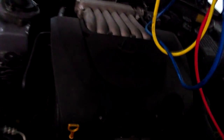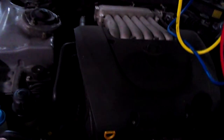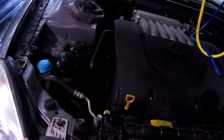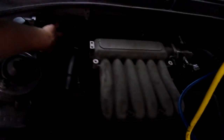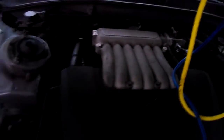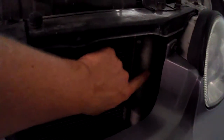Time to start a new project. Today I'm going to be fixing the air conditioner on this 2005 Hyundai Sonata. I'm going to be replacing the AC compressor, which is way down here, replacing the expansion valve, and replacing the condenser, which includes the accumulator.